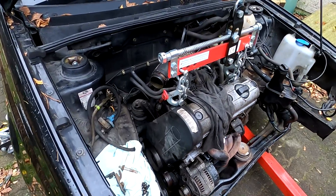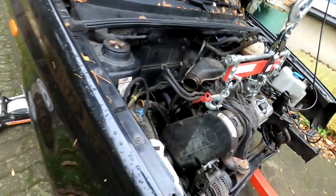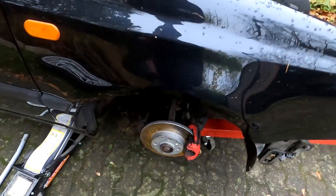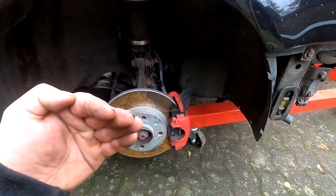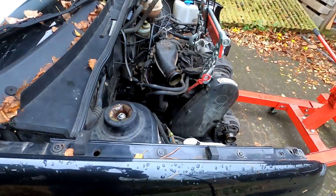The engine is almost in. I've got the problem again with the driveshaft at the back, so like last time I'm removing the wheel and pulling the axle forward so the driveshaft comes out further and we can thread it in better afterwards. Somehow it feels like it went easier last time, but anyway, it'll be in soon. Let's connect everything and then I'm so excited — you probably are too — the car just needs to run now.